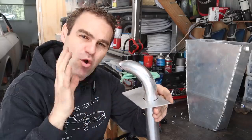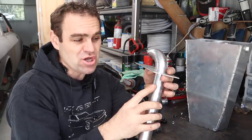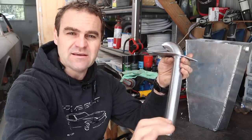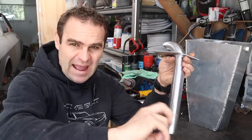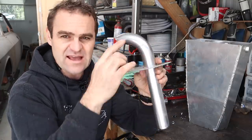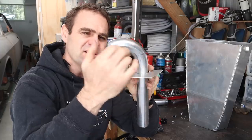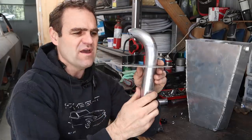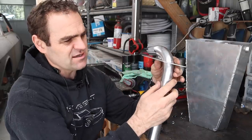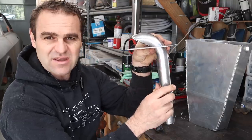What you've been watching is me working on the base of the dry sump oil tank. This is going to be the return that runs the oil back through that large dash-20 AN fitting back into the engine to recirculate the oil. What I've done, as you saw, I took an aluminium bend that I've cut off on an angle and this is the base plate of the dry sump oil tank.